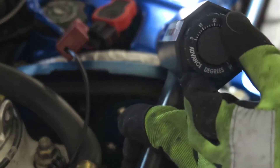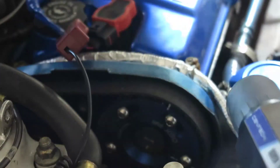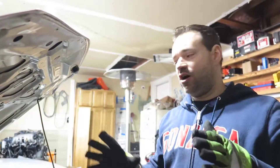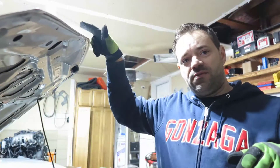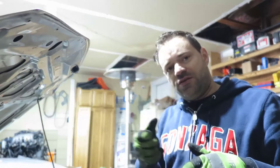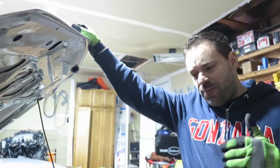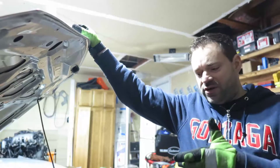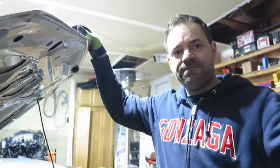I'm going to get here to zero degrees. As you can see, if I press the button I already have lights, so it's working. Now I just need to start the car. If you haven't started your car yet, turn off the fuel relay so you don't have fuel or spark. Get somebody to start the car for you, trigger the light, and see how it is. Then keep adjusting the trigger angle. My car I know zero works, so I'm going to test it as the car runs and see how many degrees it's off.